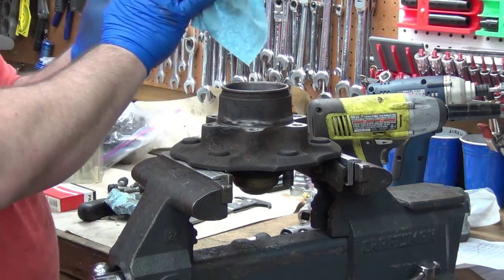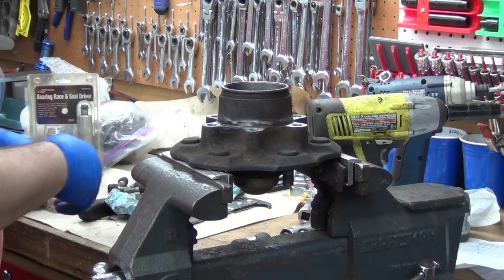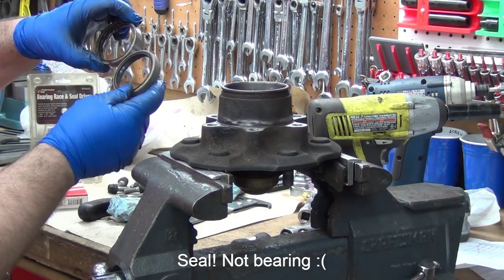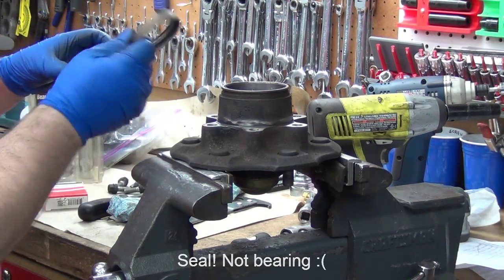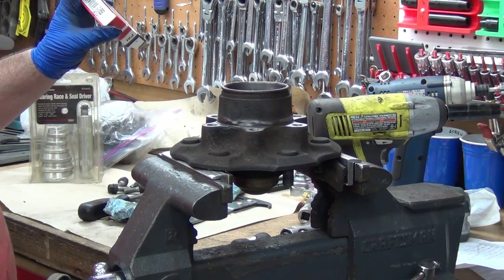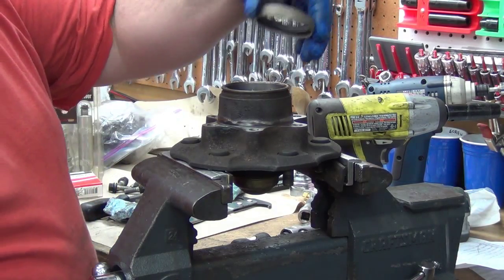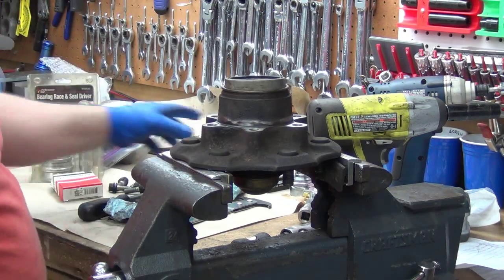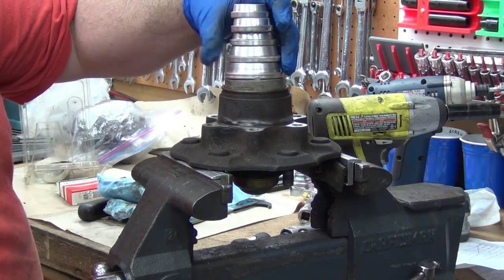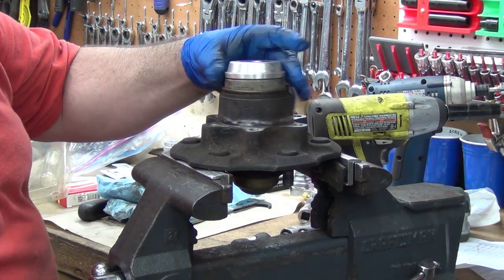Yep. I don't see any bluing or scoring or anything like that. And the owner didn't provide new bearings, so these are going back in. So, yeah, it is exactly the same bearing. These must be fairly early, because these are 79-620 seals. The FM number is 2002, and the SKF number is 21040. So, anywho, I still need to set up the seal thingy. That one looks pretty good. We're driving it down flush, so that one looks about perfect.